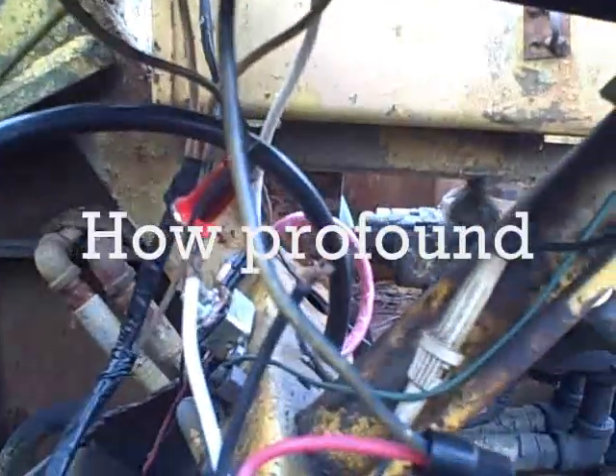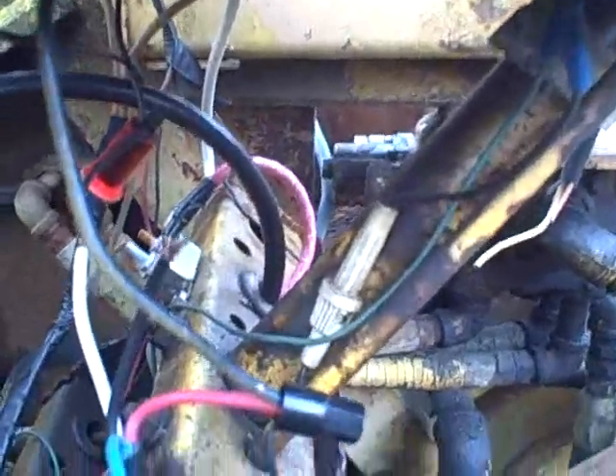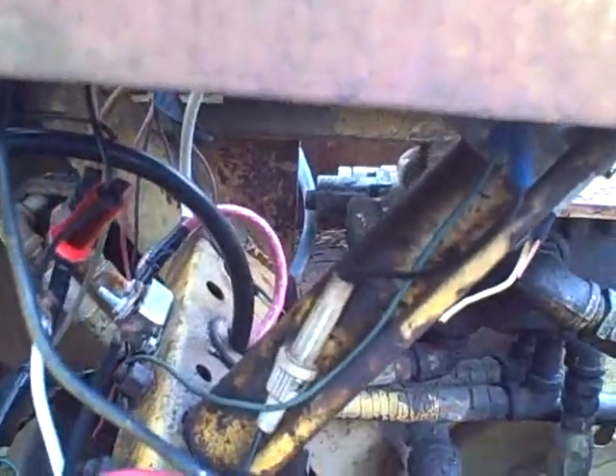Got the wire, got the alternator all bolted up and wired in, so now I can see whether or not we get what we're supposed to get. I turn the key on and that light should light — and it does. So that's good, we're getting that. Something I fixed is working. Now the question is when I start it, will it start charging? Hopefully there's enough juice left in the battery to start this thing.